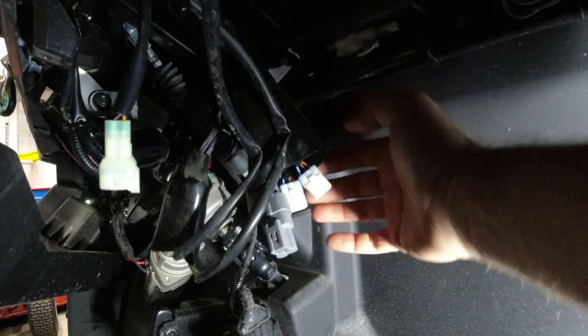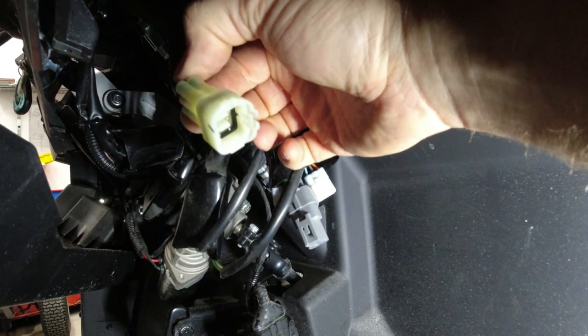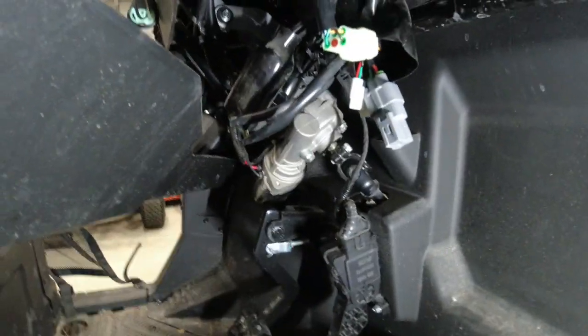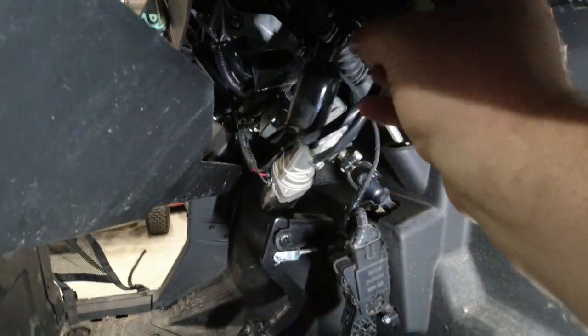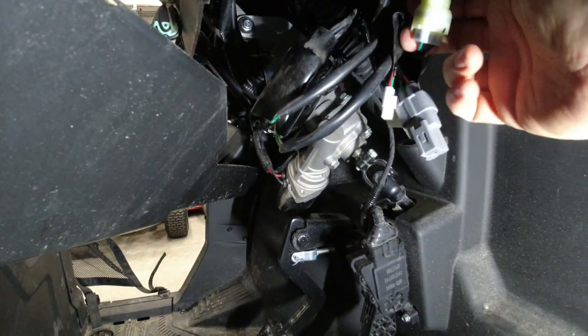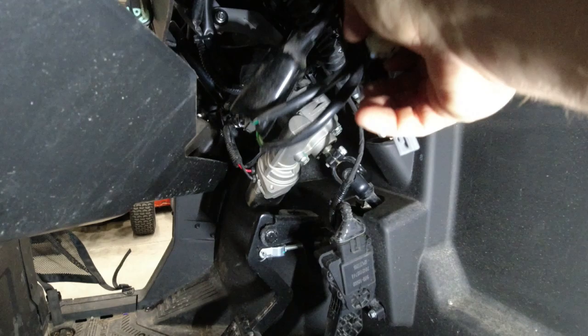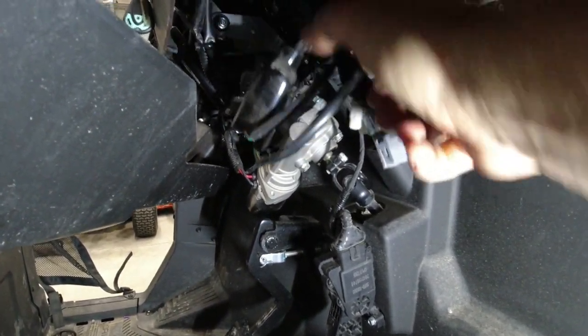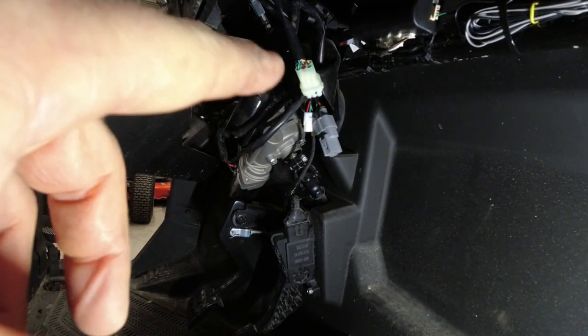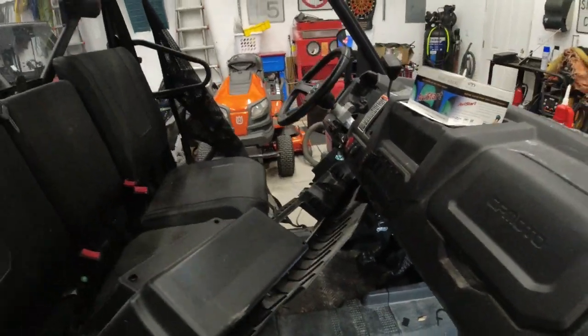You're going to find the one that your turn signal clicks into, and that'll be done. I had to shut off the camera in order to do it because it needs two hands, but I got it plugged in together. You'll notice that the wire colors match on both sides of the plugs. That's how you can tell which one you want. Make sure it's firmly seated. I put dielectric grease on that one too, just because it's the right thing to do, I think.